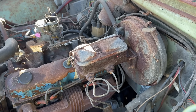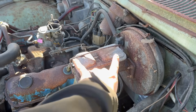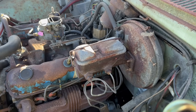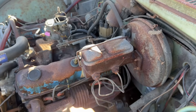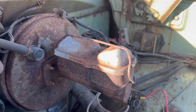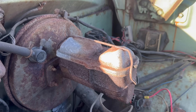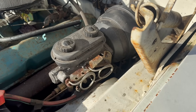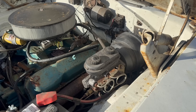There are several different versions of the dual-circuit master cylinder used in this time. Most of them look a lot like this. You've got a split reservoir here, and then a front and rear line running down to the hydraulic system. For whatever reason, the front brakes are always in the back on Chryslers. It's pretty easy to tell when you have disc brakes — the larger reservoir is going to be for the front. Later in the 70s, Chrysler developed an aluminum two-bolt master cylinder with a plastic fluid reservoir, and something a lot like that was used for decades.